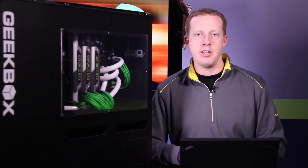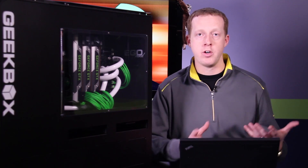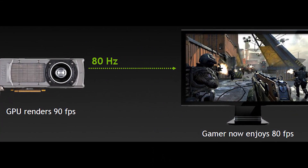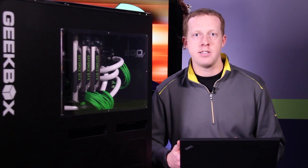Nvidia has decided that most displays can go higher than 60 Hz, so they're going to enable their partners like EVGA, ASUS, and MSI on their tools to change the information they give to the monitor. If the monitor has the capability to be overclocked, it's kind of like setting a new resolution. You say you want to push the monitor to 80 Hz, hit apply, and if the screen goes black it will revert after 10 seconds. If it works, you hit OK, and now when you enable V-Sync you'll be able to run at 80 frames per second — potentially drastically changing the gaming experience.